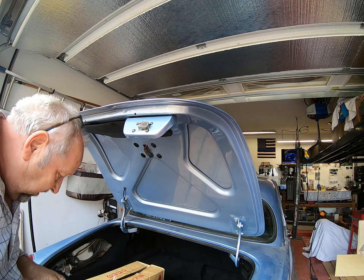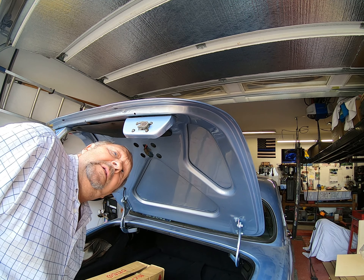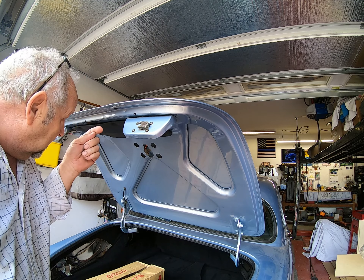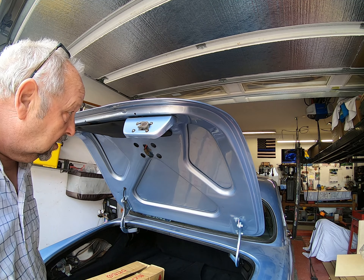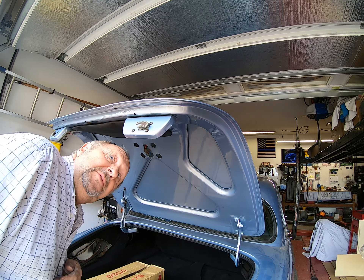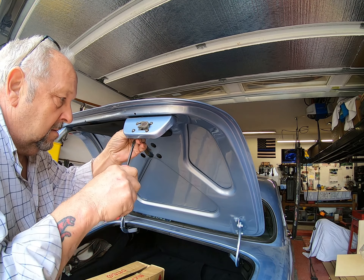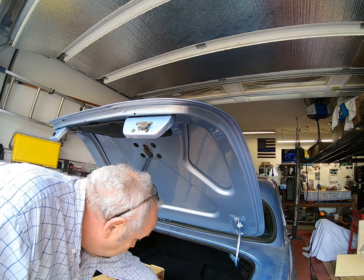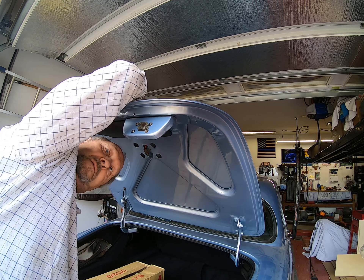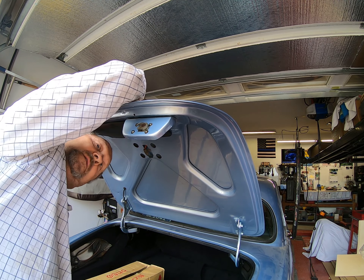Pull off the bracket - yeah, that's going nowhere. Okay, so that just comes down to a little lever mechanism. Now I have choices here: is it not being actuated somewhere, which I would have to take this cover off to find out, or is it having a problem here? So what I'm going to do is take out this little clip here - you just push it out of the way and take the rod off.